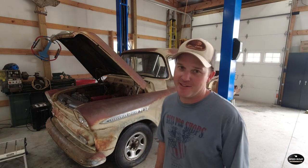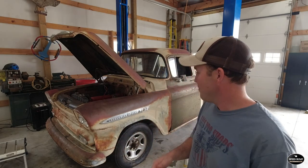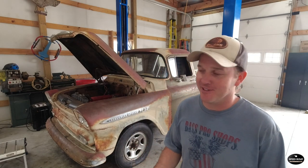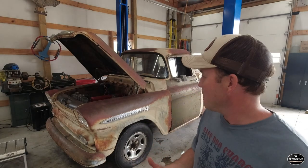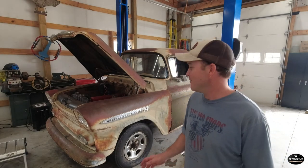Final day of this episode on the '59 Chevy, and we've got good news and bad news. Good news is we messed with it quite a bit after we filmed yesterday — I adjusted the timing, messed with the carburetor a little bit, and this thing's running good. It's idling good, it's firing up good. The bad news is this thing is smoking like a freight train. The only thing I can think is that number three cylinder where the piston was stuck had a spot I wasn't able to hone out, and I made the decision to ignore it. I think maybe that was the wrong decision — I've never put an engine together with a bad spot in a cylinder like that. We took a gamble and I don't think it worked out. It does run, but we're going to have to make some decisions on the future of this truck.